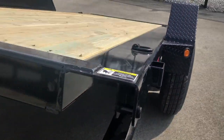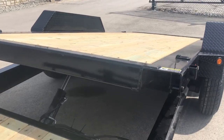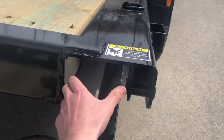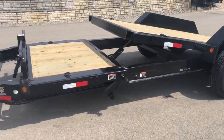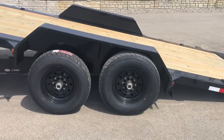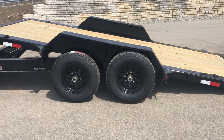Underneath you've got about 16 inch on-center cross members. This is a dual latching setup — instead of latching just in the middle, it actually latches on the outside on either side. This unit has a separate bed frame with the heavy-duty mainframe and 8 inch I-beam, so the fabricated part comes right down over the I-beam mainframe. This is a 14,000 pound unit, weighing in at about 3,500 pounds and leaving about 10,500 pounds of net legal payload, plus tongue weight, which picks up roughly another 15%.